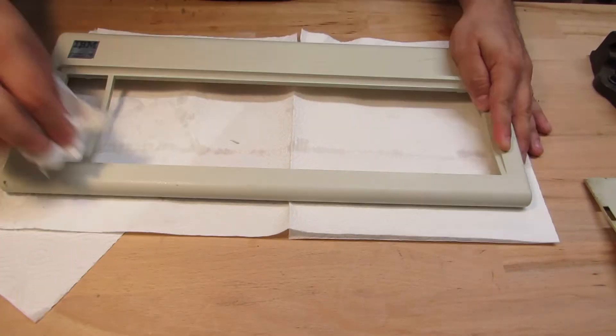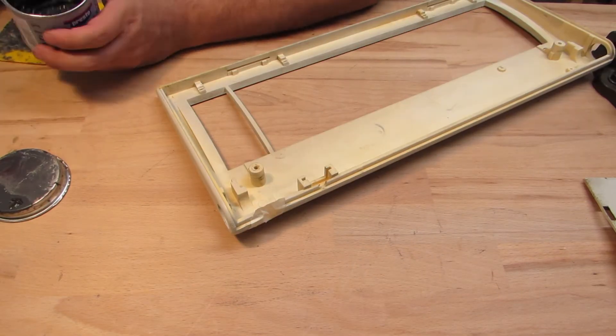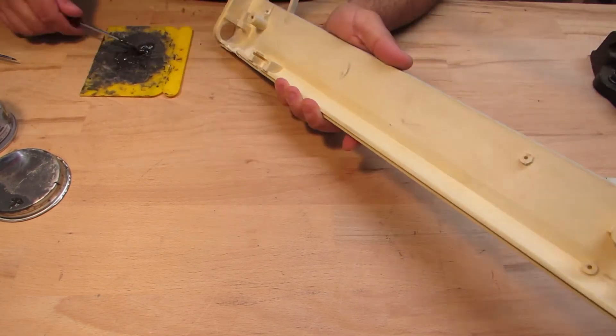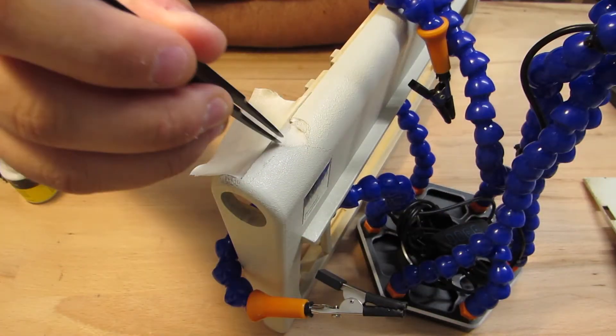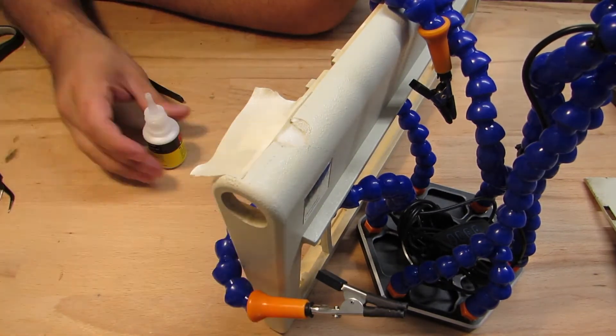The cover piece needs some love — there's definitely a lot of cleaning needed. For the big hole, I use some automotive plastics compound to reinforce it from the backside. For the front side, I use a two-component plastic super glue to fill it up.